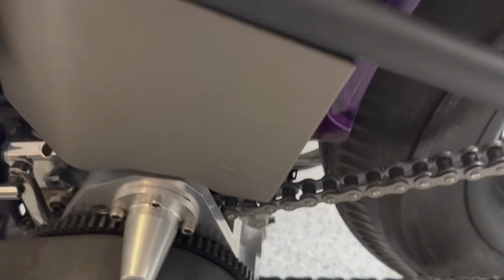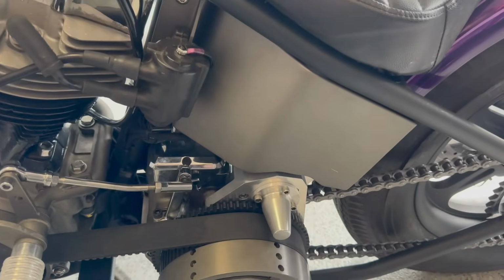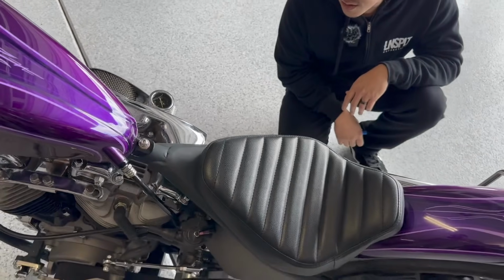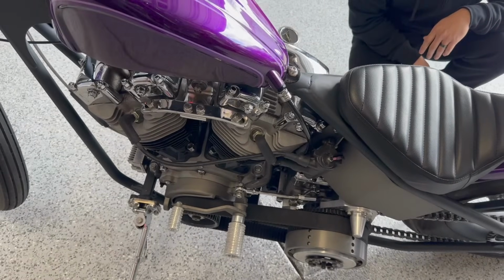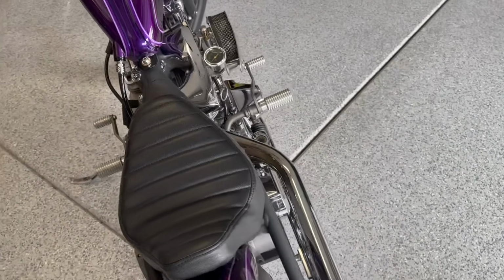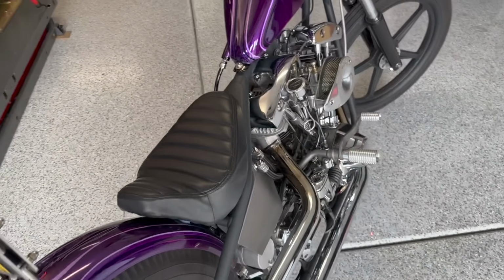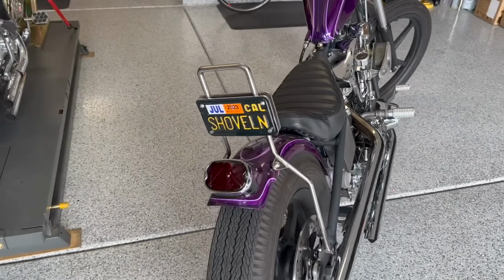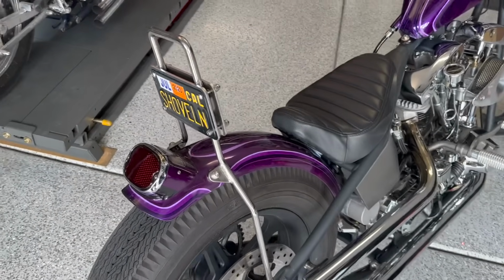I didn't have that before, and had the belt too tight, threw out the main seal, I think it's the fourth or fifth gear seal, main seal or whatever, on the transmission. That thing was leaking like crazy. Fixed that, threw the transmission plate on from Old Stuff, and it's fine now. Hasn't leaked yet. The sissy bar, where'd you say you got it from?